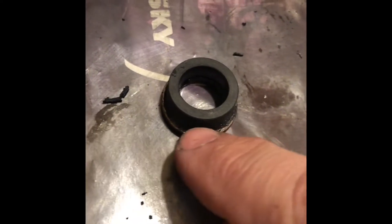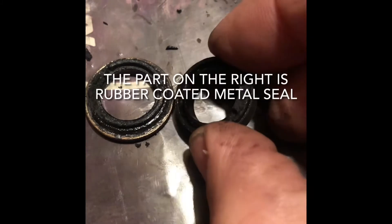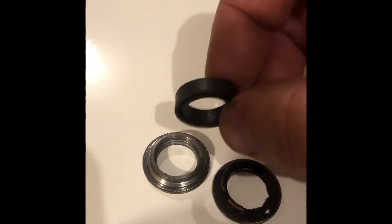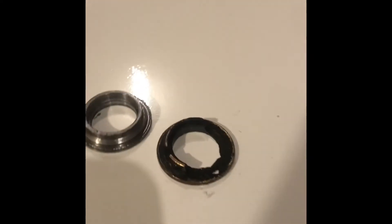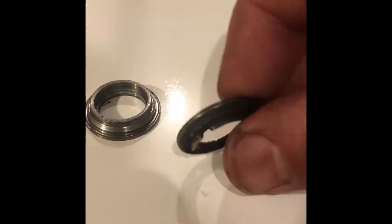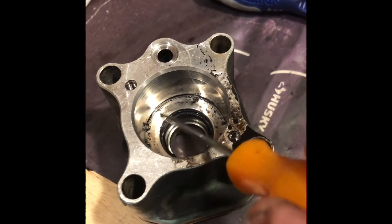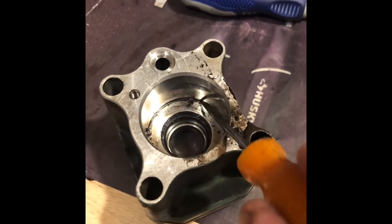Here's the culprit. Unfortunately I thought that was all one piece. I kept working on it as I cleaned this bottom edge that seemed so bad, and that came apart. That is hollow down in there. Here's the new piece I made — that sits on top of that right there. There's that guide bushing. You can see this one is just deteriorated. I made this one out of cold-rolled steel. There's actually a slit from right here to right here that goes back into the body of that, but if I put any solvent down there, it all comes out right here.